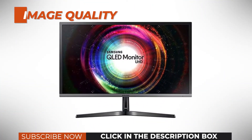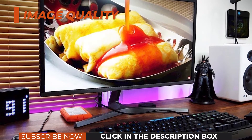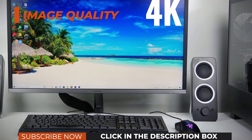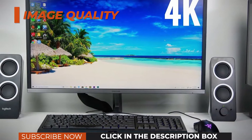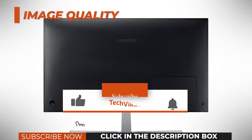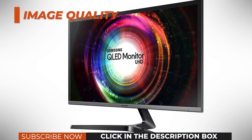Image quality. TN panels are praised for their rapid 1 millisecond response time speed which removes trailing and motion blur of fast moving objects — that's why they are ideal for fast-paced video games. However, such fast pixel transition speed comes at a cost, as TN panels also have very narrow 160/170 degree viewing angles which make the picture shift in color, contrast, and brightness when viewed from certain angles. Additionally, in comparison to IPS and VA panels, TN monitors have the worst color quality and a mediocre contrast ratio.